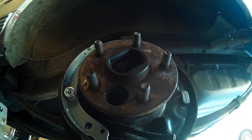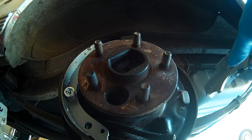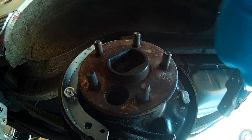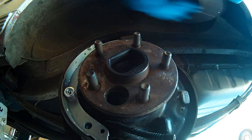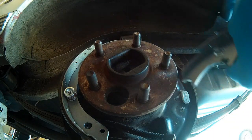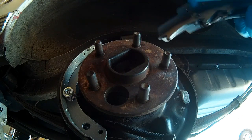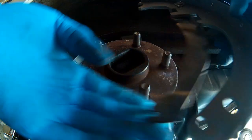For the rear shoe, we've got to install our emergency brake lever arm, which goes into this top hole here. Put a little bit of lubricant on the pin so it can freely pivot. Then we take our horseshoe clip and it just slips over the pin — just crimp the two ends together. A little crimp on the horseshoe will keep that pin from backing out and falling loose inside our backing plate. So now this shoe can go into place.